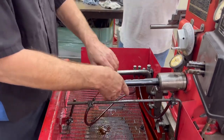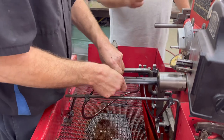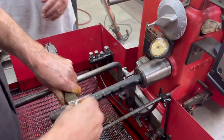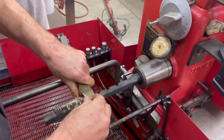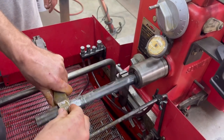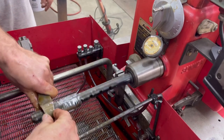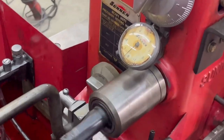But get that stroking down. You start honing. Get that thing moving. You can always come up here and bump that lever. It's a little bit of play. Keep the rod fairly straight. It went to zero. It pretty much ran out of travel there. What we'll do is we'll back that spring off and you can add more travel. Now it's starting to get a reading. You can actually see your honing stuff.